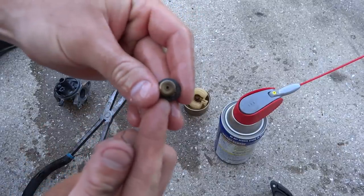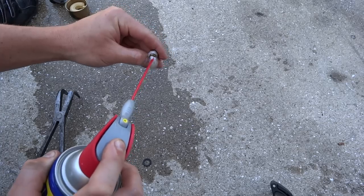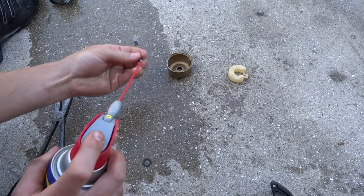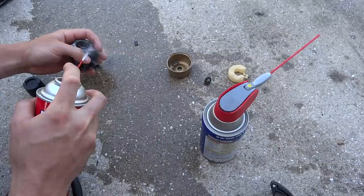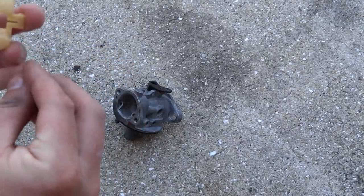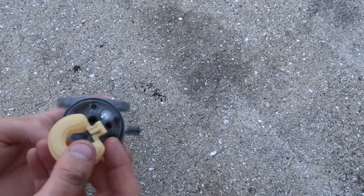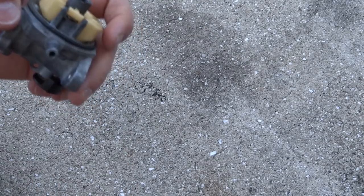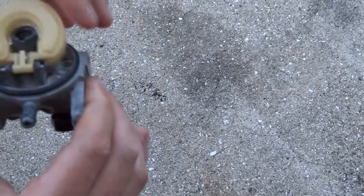We've got one more part to clean on the bottom nut here. You're going to take the washer off and just put this down in there. Now we're just going to WD-40 the float. Everything is all good and dry, so we're going to take our needle and just slide it on the bottom of the float, and our pin. We're going to flip it over and put it back in just the way we took it out — stick it in like this, then take your pin, line it up with the float, and push it in to the middle. Just like that.